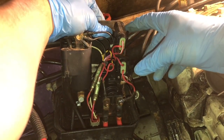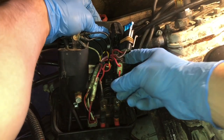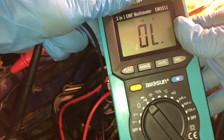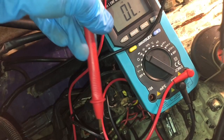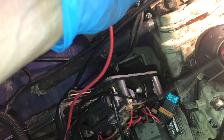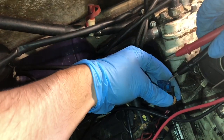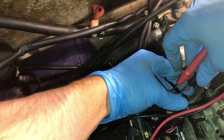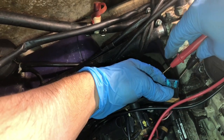Normally on a car fuses would be visible to the eye, but on a jet ski since the electrical stuff needs to be watertight you have to pop them out. Put your multimeter on a continuity setting — it has a speaker icon because it makes a noise when you have continuity. Touch your leads together and if you get continuity you're on the right setting. Then take your fuse and touch one lead to the tab on one side and one lead to the tab on the other side. If you get a beep, that fuse checks out.